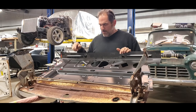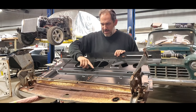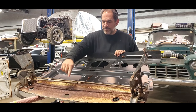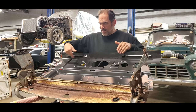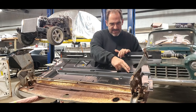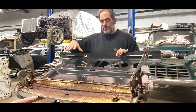I'm going to grab the camera here in a minute and kind of show you what I did. There are a couple of dimensions that are critical, and the biggest one is the dimension from where the window shelf is to where the trunk seal edge is down here — that has to be maintained. I've got some marks here and there, and we got lucky. You can see these cutout pockets, these relief pockets here, just for stamping. This is actually for strength and whatnot.